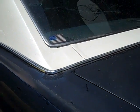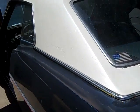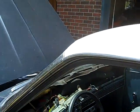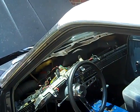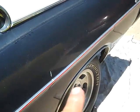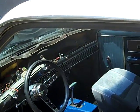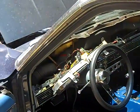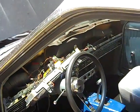What I'm going to show you today — there's another video posted on this but they left a lot out. We're going to replace the instrument cluster voltage regulator, because replacing the fuel gauge sending unit didn't do a thing. It still has the same identical problem. We checked voltage there — it was 12 volts, should have been only 6 volts. So we believe it to be the regulator.